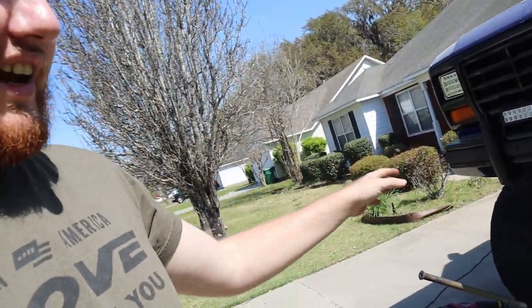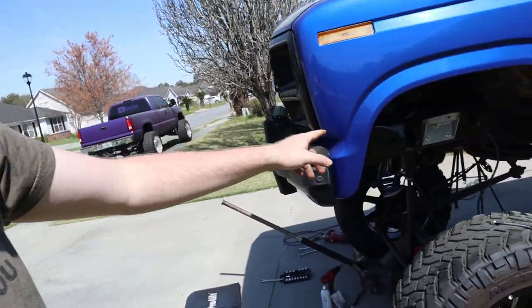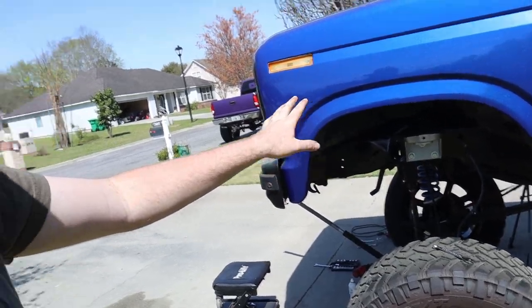We've got weight on that side. I actually had the truck sitting on the jack stand on that weight. Now I just have to take that top bolt out, put the coil tower back on, put our coil spring in, and tighten everything up, and we're done. This thing's gonna be massive. I can't wait, guys. So, stop rambling on.